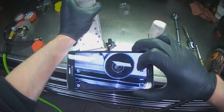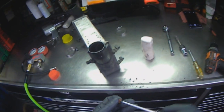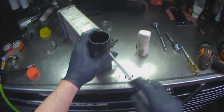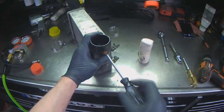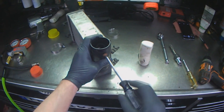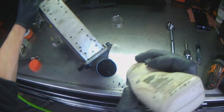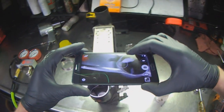I'm going to put the little screw in — I need a Phillips, sorry I wasn't prepared for that. Nothing has changed. I'm putting the little screw in as you can see, and it threads in fairly stiff and tight because I picked the right drill bit. You want to pick a small drill bit so that the screw does its own cutting — it cuts in. And you can see here, there is the screw, what it looks like with the hose off. Another picture for you skeptics.